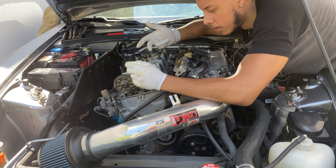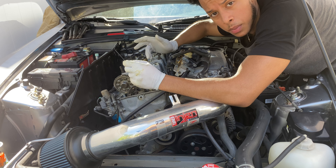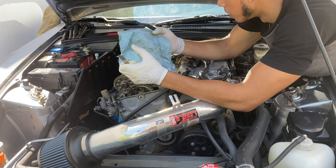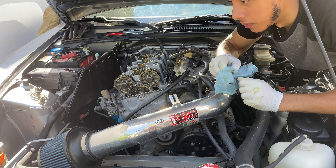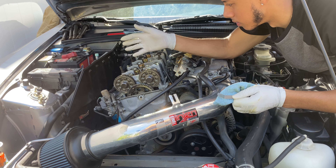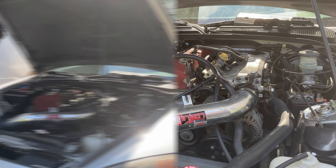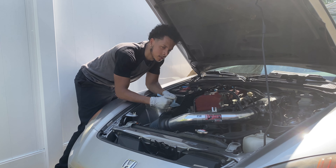You only had to adjust cylinder one — all the rest of them were fine. That's pretty cool, it means I don't have to waste any more time adjusting. Everything else is in spec, which is what you really want to see. If you keep up with the valve adjustment it shouldn't go out of spec that much. In my case only a couple needed adjustment. We're going to put the valve cover back on — that's it, you did your valve adjustment. If you found this video helpful, give it a like, comment below, and subscribe if you aren't already. See you next time!